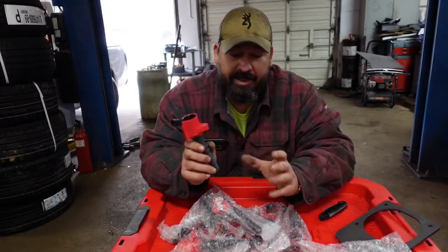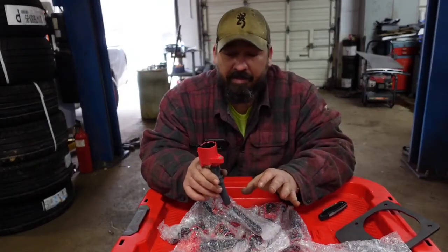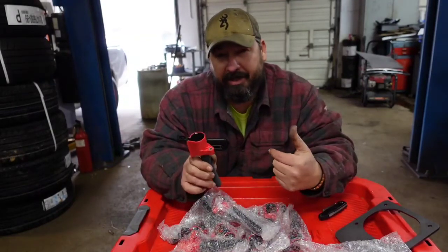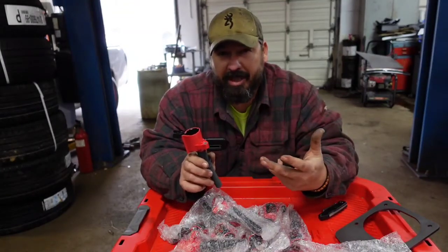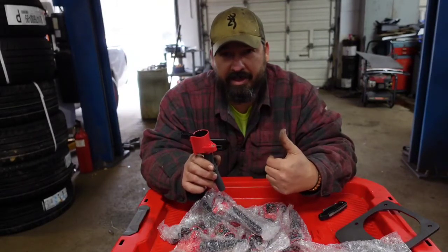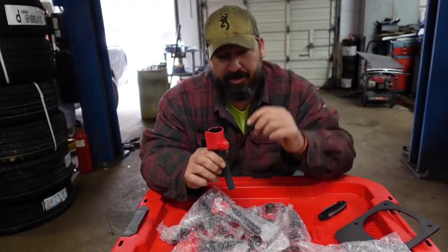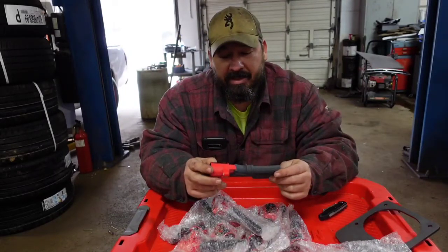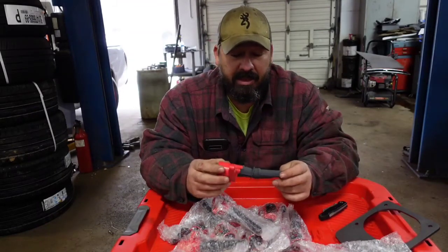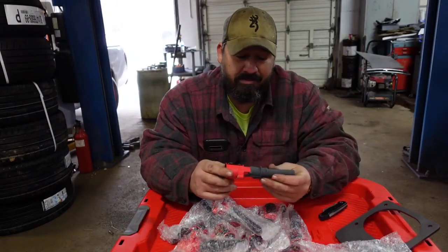What's going on with mine is it's got a valve cover leak. When valve covers leak, it leaks down the boot inside where the tube seals are. If you take a shop vac and vacuum out the hole and clean it out, you won't have to deal with it for a long time. The driver's side has a water leak somewhere that gets moisture on the third coil back, causing a horrible miss. I've had this truck probably seven to ten years and this is probably the third set of coil packs - they're super cheap off eBay, about 40-50 bucks for ten.